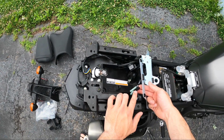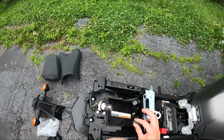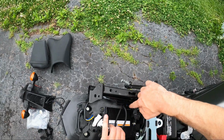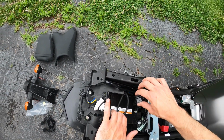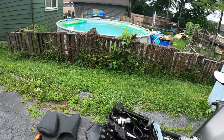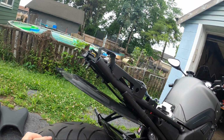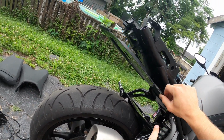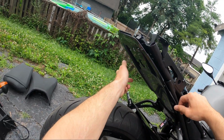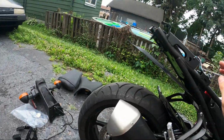Our right turn signal was this black one here. The old LED plate light was these two spots here. And then our left turn signal is right here, this gray snap right there. And then our brake light is right here. This piece I just have hanging right now. It's hanging on by 2 push pins down there. I kept those 2 push pins on because this doesn't need to come off. I just have the 6 push pins removed that were helping to hold this rear cowl assembly in.